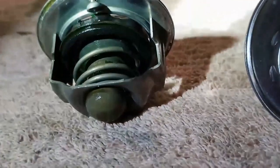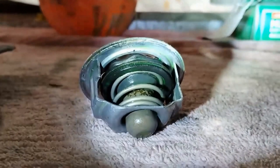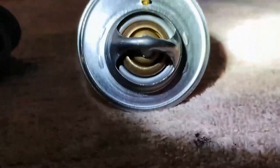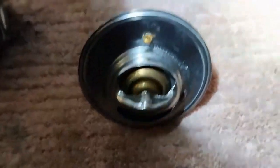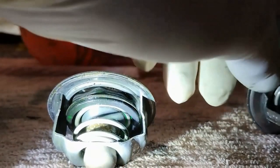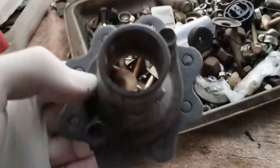You can see a hole on the right-hand side of the old thermostat. I'm very pleased to be getting this work done because the car does 85 kilometers a day. There's a little bit of debris there. The new one — that's how it should look, there's no gap. That's a good healthy thermostat. The old one is a real mess. We can see the seal there, and this one is properly shut.